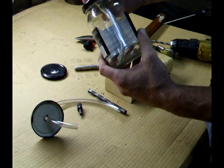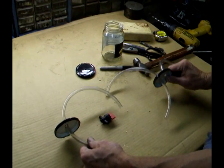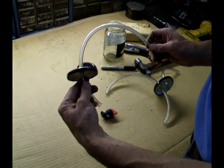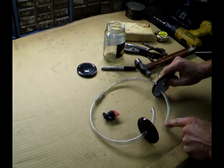That's my little trap there to catch the brake fluid. Now that I have my hoses pulled through the lids, I have a barb here and I'm going to hook this up. This part will go to the master cylinder — push this barb on here — and this will go to the bottom of the pickle jar.